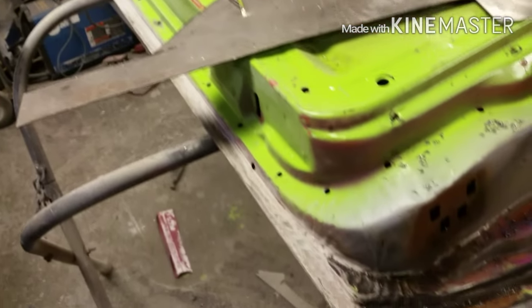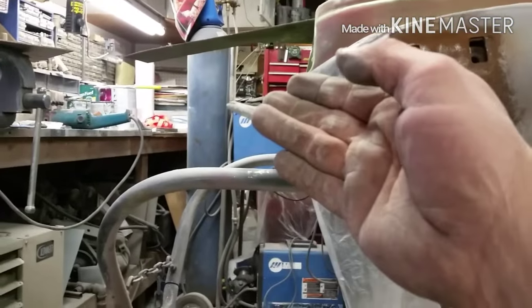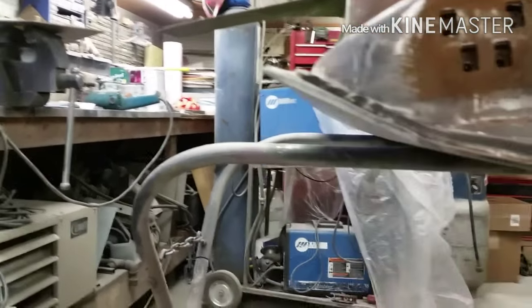The lip on the back side of the door was pretty rotten. I fixed that up with a little fiberglass resin — just pitted kind of thing — ground it all down. It'll smooth out; no one's going to see it. It's been stripped down through multiple colors like everything else on this car. I redid the filler — cut it all out. There were some good solid patches but they'd laid the metal over top of the other metal, so I hammered them down to get the profile a bit thinner. The patch was good, solid metal, not rotten — just too much filler.